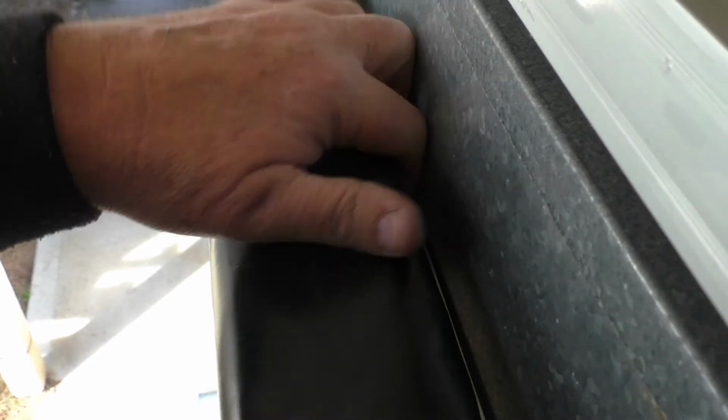Okay, so that's both of the awnings on, but as you can see on the side here, it's not quite flush. So what I'm going to have to do is run a bead of silicone along the back there. I'll get to that a little bit later. There's no urgency because we're under the carport for a while. But before we go away, I'll definitely run a bead of silicone there just to waterproof it. Because what we're going to do next when they arrive is put a couple of LED lights up under the awning here somewhere. It's an orange and white light LED.